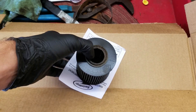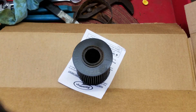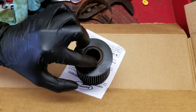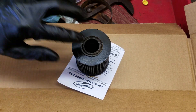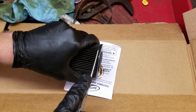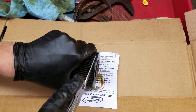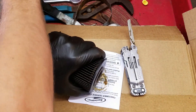Let's open up our oil filter after running the AutoRX through it for 3,300 miles. This is a FRAM oil filter and I don't know how good a job it actually did catching a lot of the particles — it looks like quite a few of them made it through into the oil filter housing because of the seal design. There's a felt or paper on top and on the bottom there's not actually a rubber gasket or seal, so I think we were getting a lot of bypass flow. Please don't buy FRAM filters — they are absolutely garbage. I also went ahead and did a pleat count: this filter had 51 pleats and a WIX filter, which I should have used, has 70 pleats — quite a big difference in filtering material.